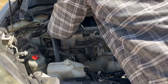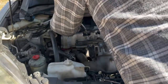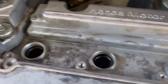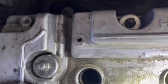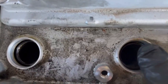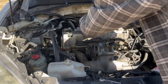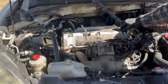Notice I'm pushing the cover down and it doesn't really seem to be fitting well. This is where I made my mistake last time — I went ahead and just tightened the cover down because I felt like everything was correct, but it's not. Let's go in and take a look at why it's not going down. See the seals we just put in? The one in the second hole to the right looks pretty straight. But when we look at this one, see how it's kind of off-center? We need to pull that back in and make sure the valve cover is going to evenly go over the oil tube. If you force it down, it will just split the seal, which is what happened to me. Make sure you get all of those correct before you go putting the acorn nuts back on to the valve cover.